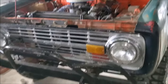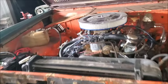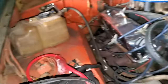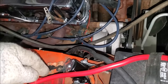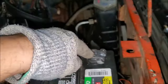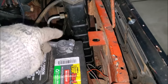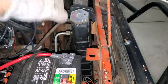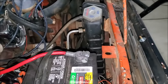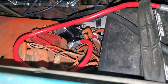In this case I've got a '75 Bronco right here, and the client told me about that issue. He basically pulled the cable off because he had a wrench handy and was able to get the positive cable off and it stopped cranking. But anytime he would touch the cable on the positive it would start to crank again.